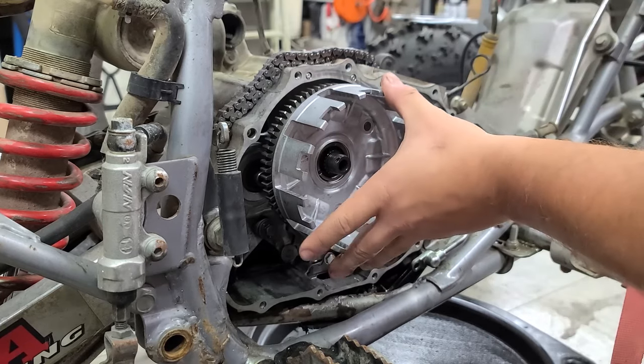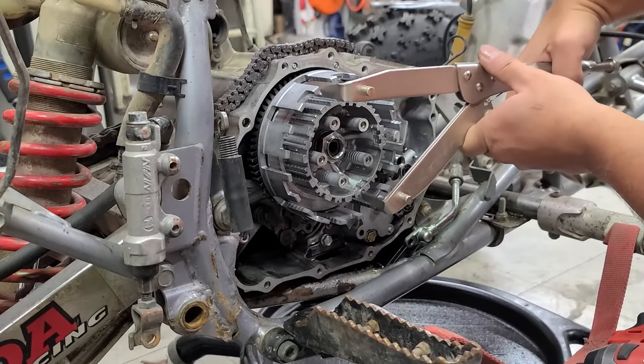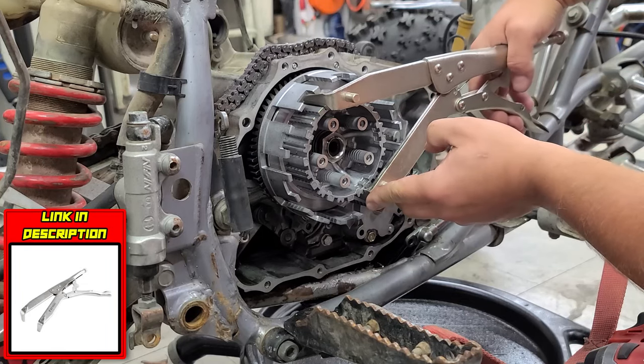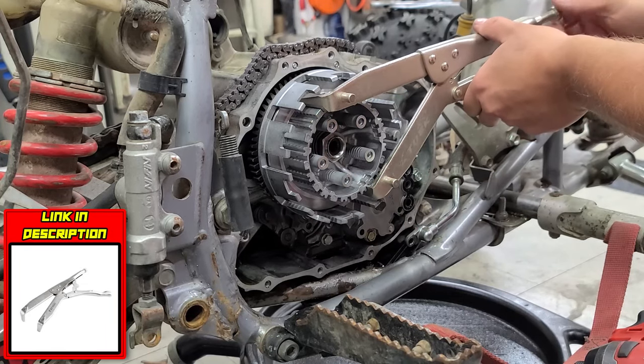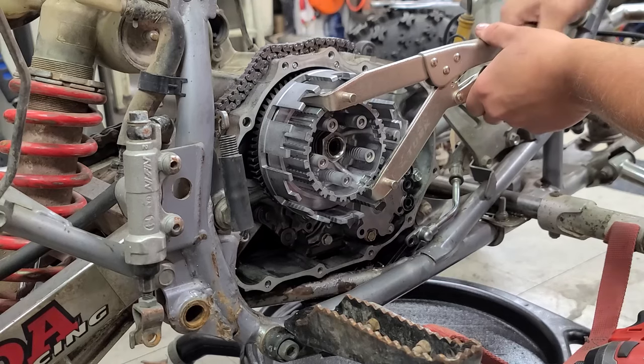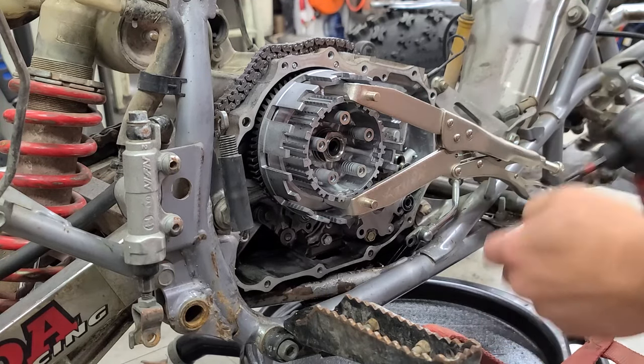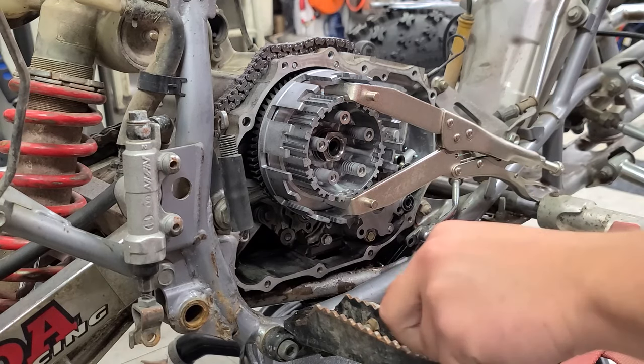Now we're gonna use our Tusk clutch holding tool to hold the inner hub while we tighten this thing up. I love this tool. I'll have this linked in the description below. Honestly, it's worth buying even if you're only doing one engine. It's like 10 bucks and it enables you to torque this down to the correct tightening torque. It's a great tool to have.